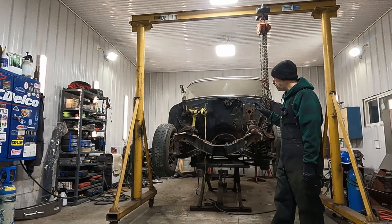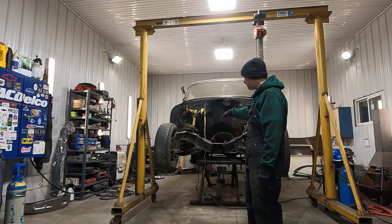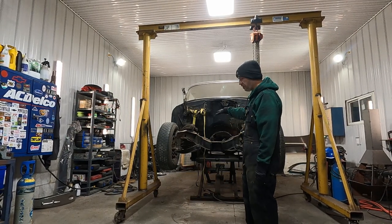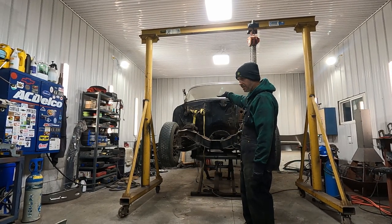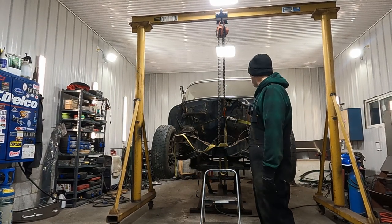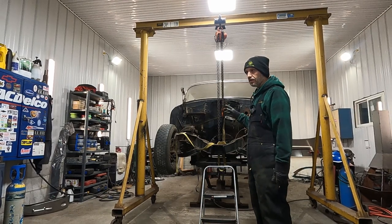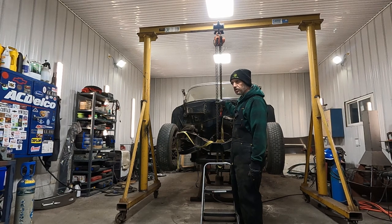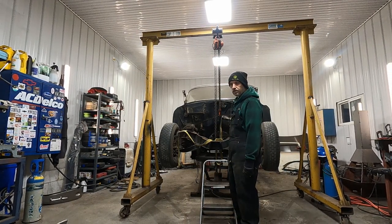Before I get too carried away, I'm going to support the front of the car — the back's already supported. I let the scissor lift down; it isn't fully extended because I need room to grab the body once the chassis is out. I left it down as low as those stands would go, which I think is about the right height. I need the body to stay in its spot but the scissor lift to have enough travel to come back and pick up the body.